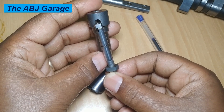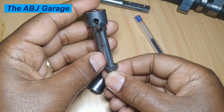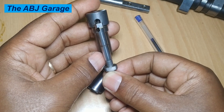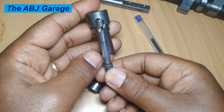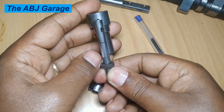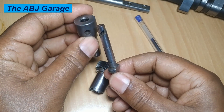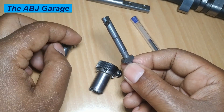When you release the shutoff lever, spring forces return the plunger to the idle position. At idle the plunger is positioned for minimum delivery; when you accelerate, it rotates to the increased-delivery position; when you let go of the accelerator pedal, it returns to idle again. This is how fuel injection volume is varied in this type of inline injection pump.